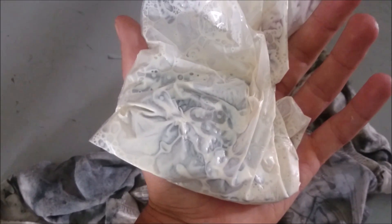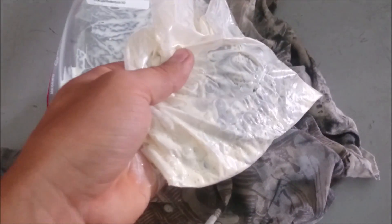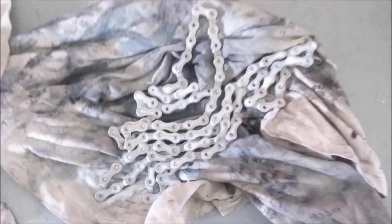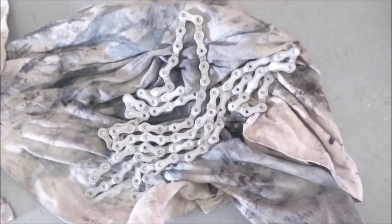I'm going to put it out in the sun so the lube gets thinner and more of it gets into the chain. I have left the chain outside in the sun so it's nice and warm and absorbs all the lube it can get. Now I'm going to remove the excess with this rag and mount the chain.